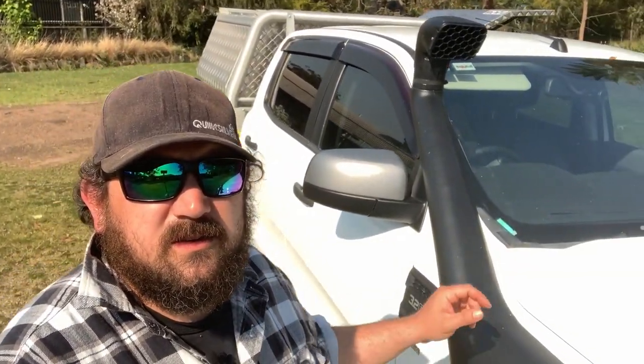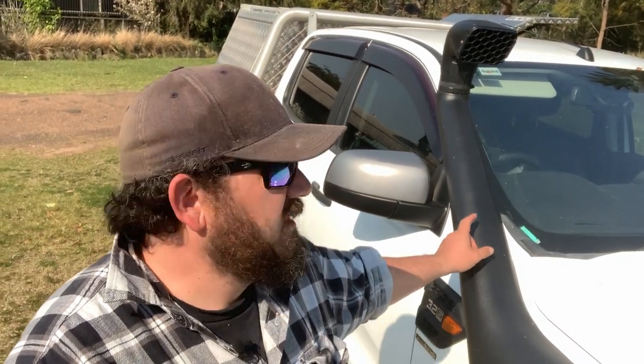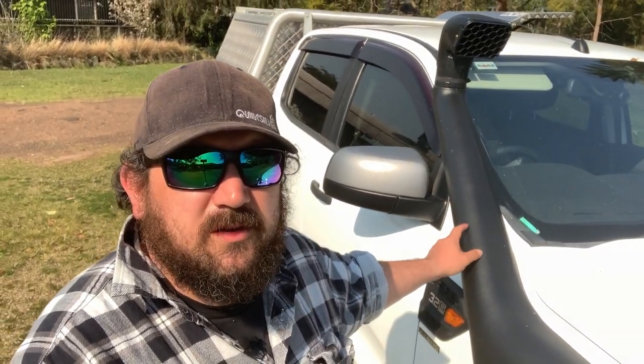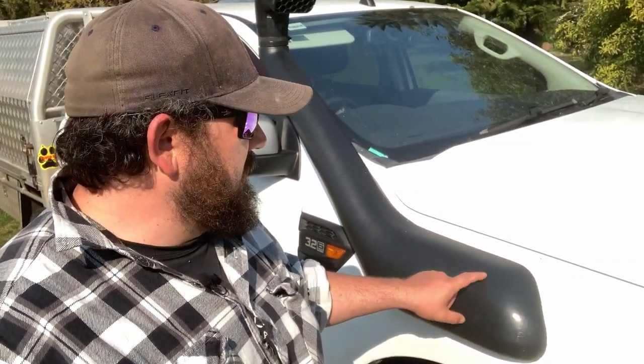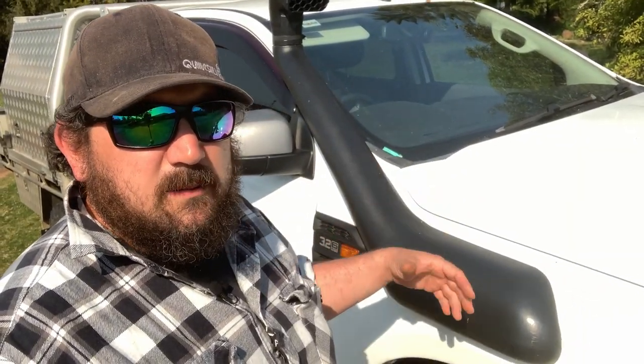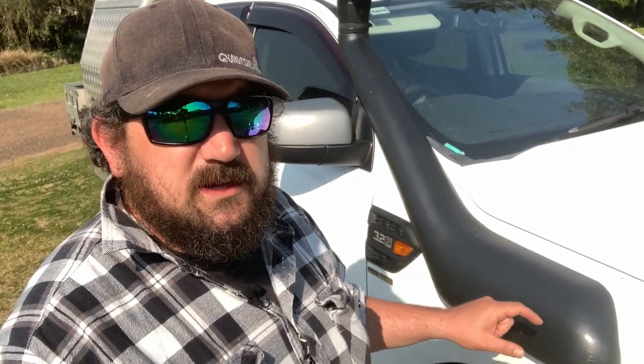We also have a Dobbinson's snorkel here. I picked this up off eBay pretty cheap and fitted it myself. It was a bit scary taking a big 108mm hole saw to the side panel, but I measured it out many times before cutting the hole. It still wasn't 100% right but I used a die grinder to shape it out a bit more and got it fitted properly.